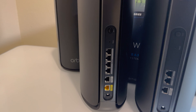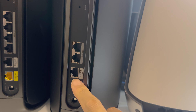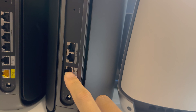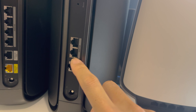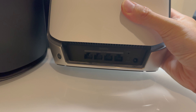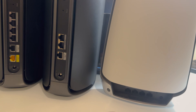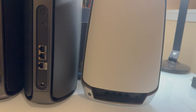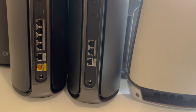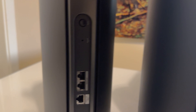One thing that could be a little disappointing: if you look at the satellite, you'll notice we only have three ethernet ports. While it is nice that they provide one 10G ethernet port — ideally you can connect that to a 10G switch — the satellite includes two 2.5G ethernet ports and one 10G port. This is compared to four 1 gigabit ports on the prior Orbi 6 series. So each satellite hardwired can only support three devices, and you may need to piggyback a switch depending on your configuration.